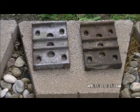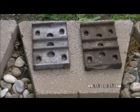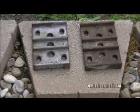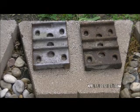Well, when the air compressor is generating that compressed air, with the cylinder pushing down, it creates heat. And when hot meets cold and such, some physics stuff, you get water, condensation. So the condensation that's coming from the tank into my hose is clogging my stuff up. And nothing's really coming out of my little siphon gun. So I had to clean out the siphon gun and whatnot.